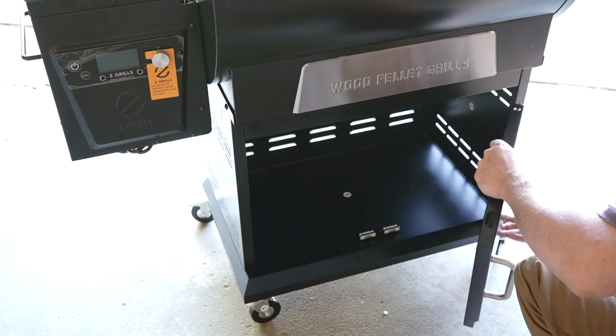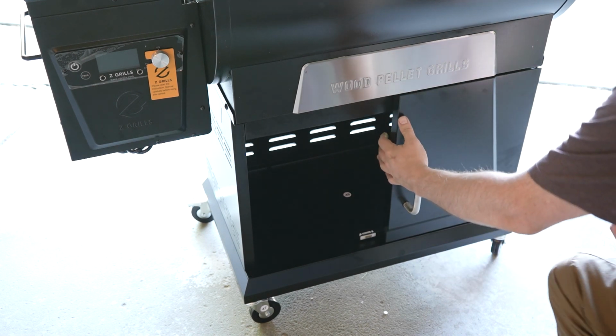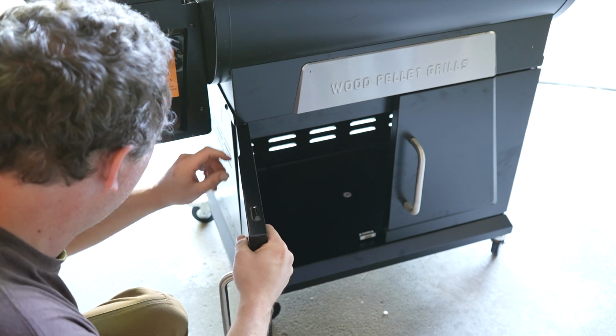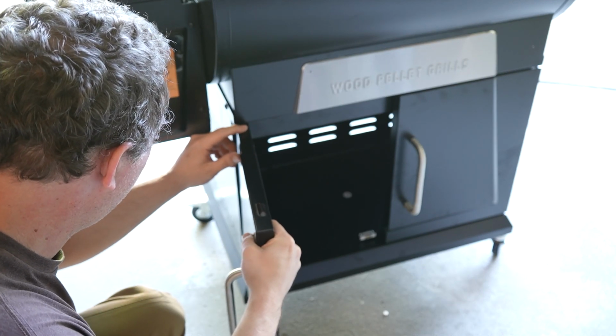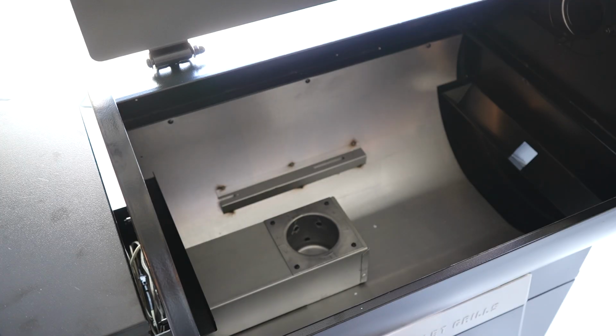Place the bottom fixed pin into the small hinge hole in the cabinet's base, then press down the top spring-loaded pin and position the door into place. When the top pin finds the top hole, it'll snap into place and the door is now attached. Then simply repeat with the second door. Step 12.